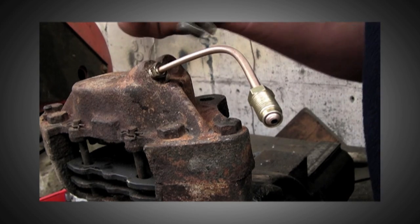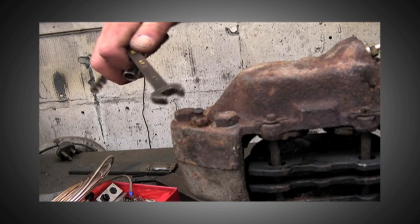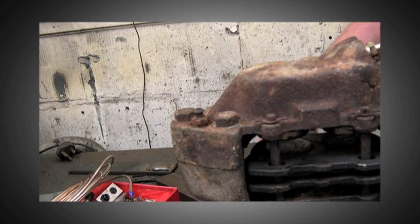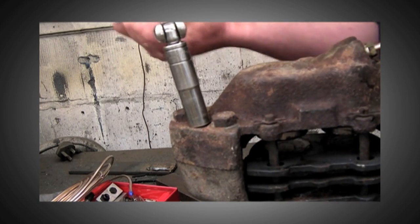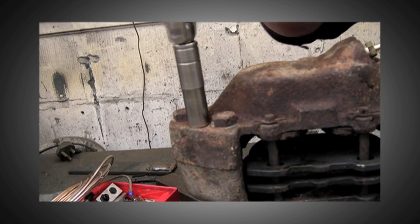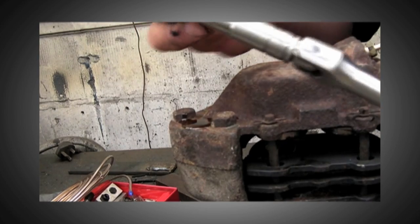With copper pipes I've just made up, a lot of the time you may not want to do the pipes, but you have to bleed something. If a spanner won't work on a bleed nipple, don't push it. Use an 11mm hexagonal socket - not much force - and that should come undone, as you can see in the video.